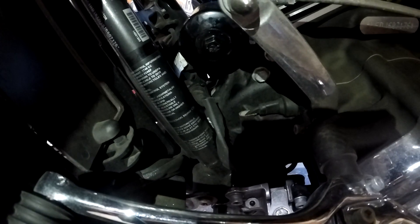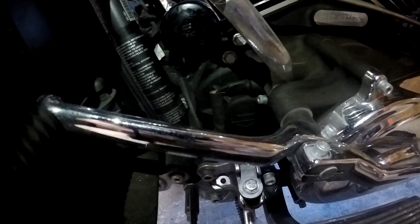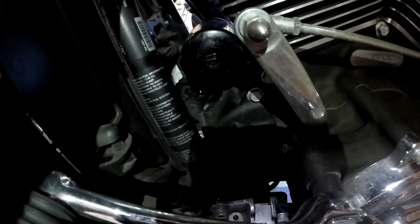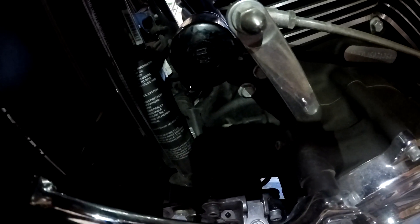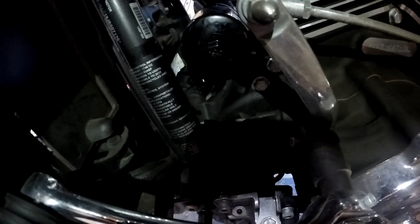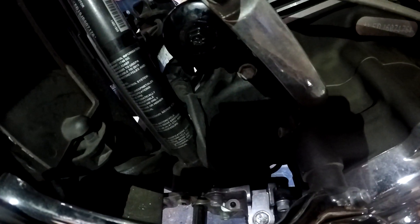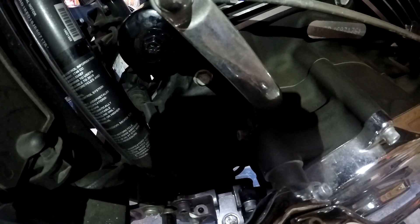Once you get the drain plug out, make sure your dipstick is released and all the oil has drained out of the bike — down to a drip. Then come in here and loosen up your filter. Like I said, there was a chrome one on it. It sits right at the front of the motor and you're going to make a mess. I've read where people will put tin foil underneath or stuff shop rags in there to try and limit the oil spill. I tried all that and still puked oil all over the floor. It's going to happen. With all the stuff on the front of the Ultras, you can't really get in there, so you're going to have a little bit of cleanup to do. It's really not that big of a deal — just part of the process.